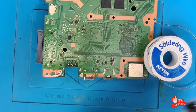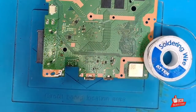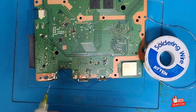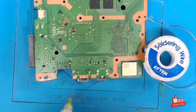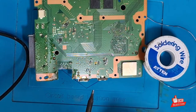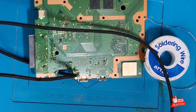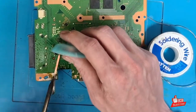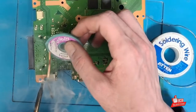That's the old port gone. Now I'm going to clean up that area — clean up the ground holes and also clean up the pads on the back, put some fresh solder on the back pads, and then we can take a port off a donor board and drop it onto this one. I'll add some flux. I did notice quite a lot of that solder spilled out onto the ground plane — that's not too much of a big deal. I'll use some solder wick — Goot wick — it's really nice, cheap, and does the job fantastically. Those holes are cleaned out perfectly.